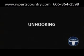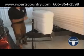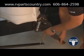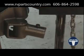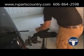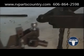Unhooking: Unhook safety chains and electrical cable. Take weight off of vehicle. Release both rotating latches by rotating and pulling the bracket lock pin. Disconnect spring bars by turning 90 degrees or pulling out the pins. Unhook the trailer coupler from the hitch. It is optional to remove the SwayPro from the towed vehicle.